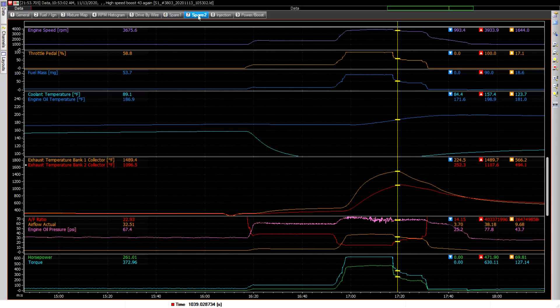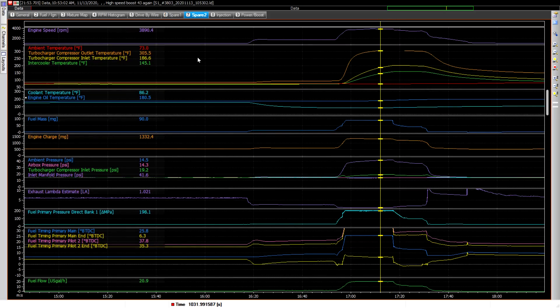Going over to the other screens: the air temp coming out of the turbo is back to where it was before because of that extra boost - 305°F before the sensor stops reading, and based on how level that is I don't think it even gets to 310. The first intercooler is doing a pretty good job, knocking off about 105 degrees - 305 down to 202, so 103 degrees. And back here it was better because it hadn't heat-soaked yet. It seems to be stabilising pretty decently there. The second intercooler is still helping by another 40 degrees - that's the one with fuel running through it, and I did have that turned on.